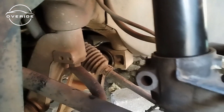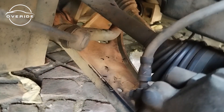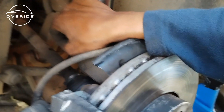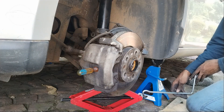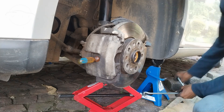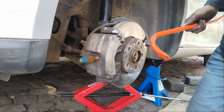The thing which aligns the shock is in right here. I took the CV axle back in, so the axle is in. What I want to do now is tighten the ball joint nuts, then jack up the car from the control arm. When jacking up from the control arm, I'll spread it up — when I spread the knuckle, it will push the knuckle up against the shock and the shock will sit where it needs to be. The hardest part is done because the CV axle can now fit inside the wheel bearing. Now I'm going to hit the knuckle so the shock slides down.